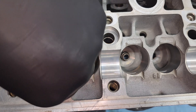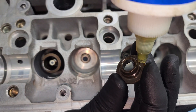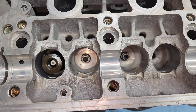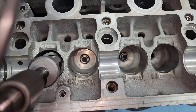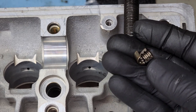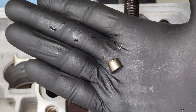Next we're going to set our valve spring in there just like that. We're going to lubricate the top keeper - or the top spring seat, whatever you want to call it - just like that. Now we're going to compress it and put the two retainers in. The two top retainer keepers - you can see that they're angled, and the narrow end goes facing down.